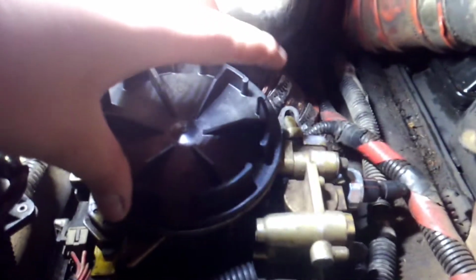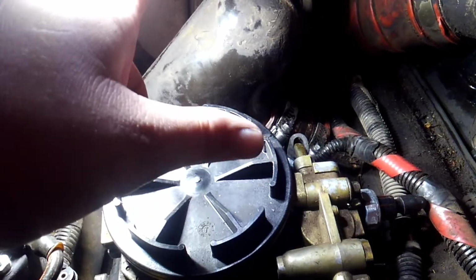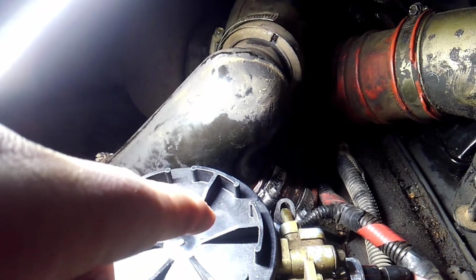And then you can get to your fuel pump, and you take your back, it's a 1.25 inch bolt. You take that out, which is no easy task. That's not fun, but you can get your fingers back in there and spin it easy enough.